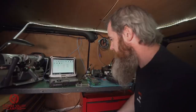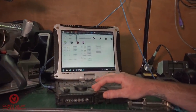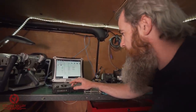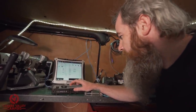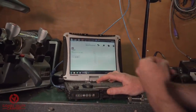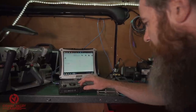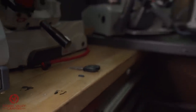What we're going to do is get the engine code number, which is on a sticker underneath there, and see if we can pull the pin code. So this particular vehicle — the Volkswagen T4, a 2002 model — what we need to do is generate a transponder, which is the correct transponder for that vehicle. It's an ID44 Volkswagen chip, and on this software we can generate the chip to be programmed into the vehicle. So if I go to ID44, click VAG, put this chip into the machine, and it will write. There we go — that chip is now ready to be programmed into our vehicle.